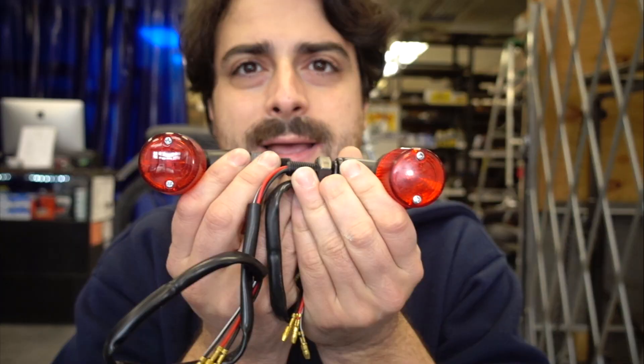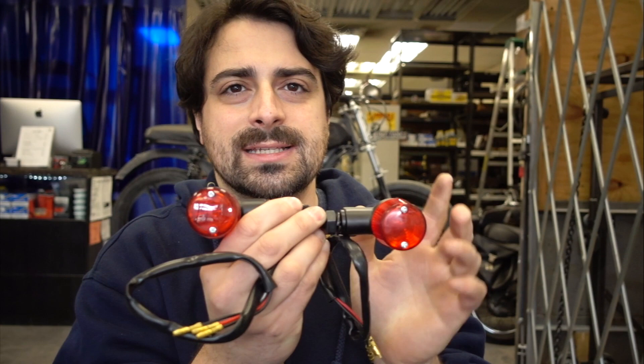Now the taillight, I'm not sure. I have something like this — I'm thinking something like this in the back. Seats would be here. The only thing is that running two bulbs as a running taillight could drain the lighting power a little bit, so the headlight won't be as bright because the taillights are taking up a lot of juice. They're sharing the available wattage between three bulbs instead of two.